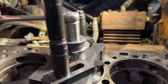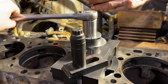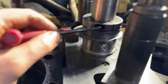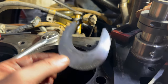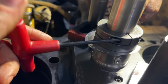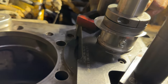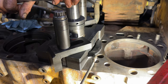Got our setup back up there. Got the shims in so we can do the center, just get the tool torqued down again. We're sitting at 18 thou for height and we want to be at 8, so we're going to cut 10 thou out now. Take our 10 thou shim, put it under there, get it good and tight, pull it out — now we're ready to cut.